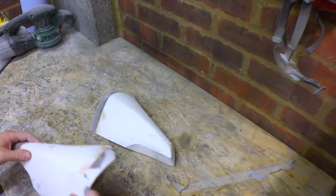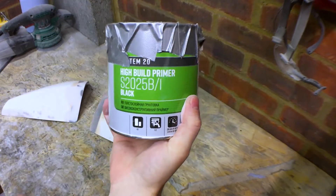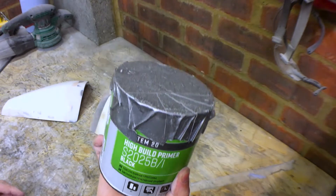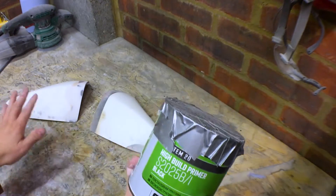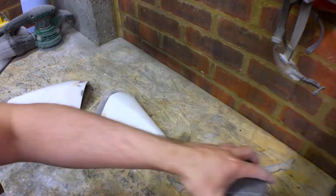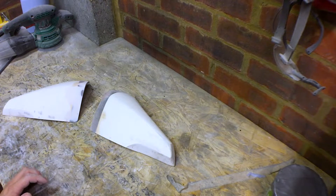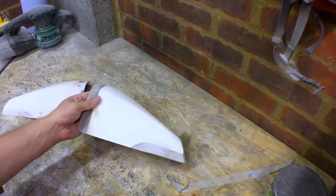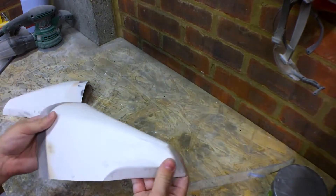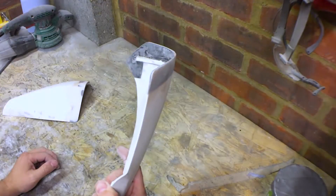You will notice on this one I've gone over with some spot filler — you see like that there, it looks like dust on it, that's actually all the little holes in the filler, which have all been filled in. I've got some 2K high build primer that turned up the other day — hopefully with a couple of coats of that and being blocked out again it should be as smooth as I'm going to be able to get it. It probably won't be perfect but it'll be near enough, especially for me.